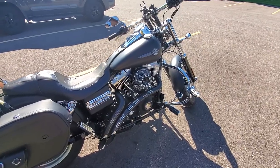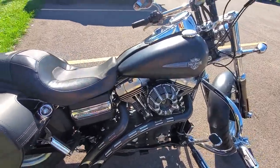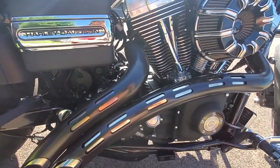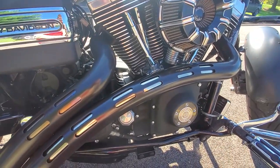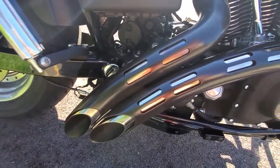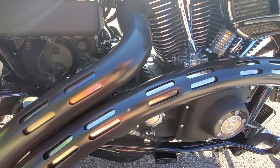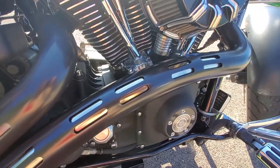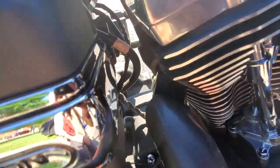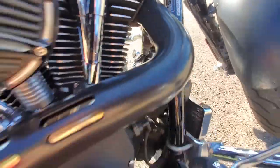Guys, one thing I wanted to show you: first of all, on this exhaust, I was running the tune incorrectly. Basically, it was running really rich. There was a lot of popping going on, and I polished this exhaust again because the whole thing basically turned blue. I don't know if you can really see it. If I come around to the front here, maybe. Yeah, there you go. You see the bluing on the exhaust behind the heat shield there?